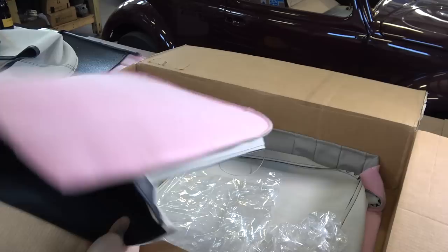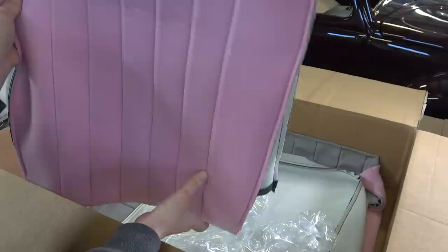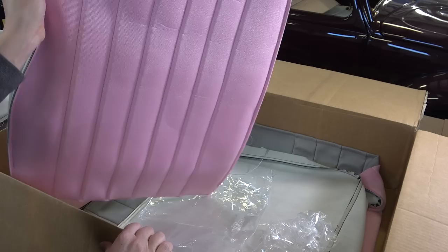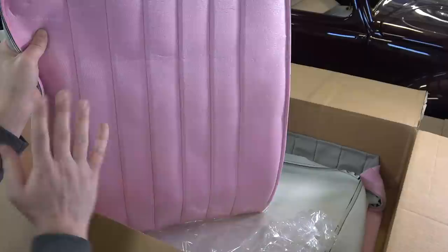And again, nice layer of foam here in addition to the foam you're going to use. Now, I like using TMI foam to pad my seats. I think the TMI foam is excellent. It's nice high-density foam, and it really makes the seat nice and posh. You could go with Wolfsburg West. They do have the so-called horsehair, original style kind of material, but they use like a cocoa fiber, I think, now. So it doesn't kind of shred apart and give you the same feel. It's a harder feel on your tush. The foam, of course, is a little softer. But I feel with the horsehair, I need to put an extra layer on the horsehair in order to give me the tightness that I want on my seat.